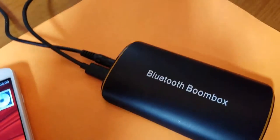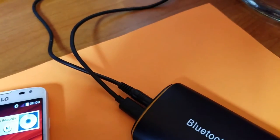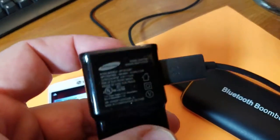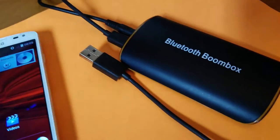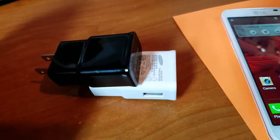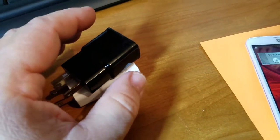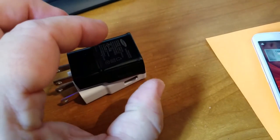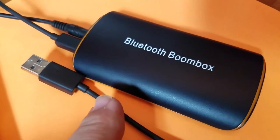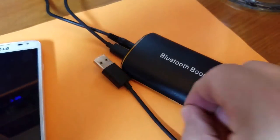I'm charging it right now through this cable into one of the hot Samsung wall warts. By the way, if you're going to power this with a wall wart you need a really good one, because with cheaper block-style adapters I actually get AC hum through the speaker. This unit does not have a very good filtering circuit in the power supply. I plugged it into my home computer and you can hear that hum — not cool.